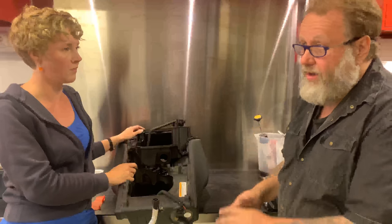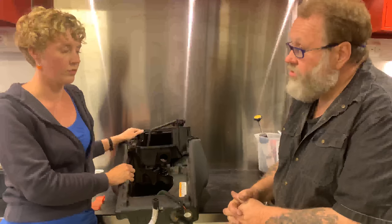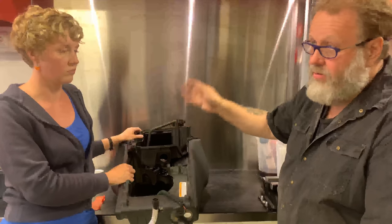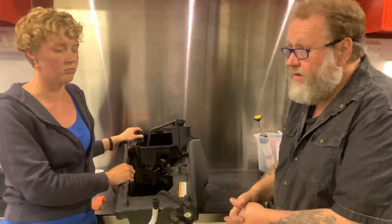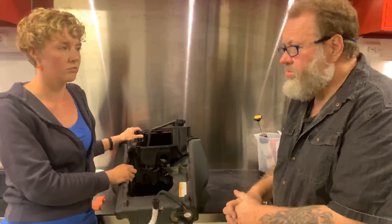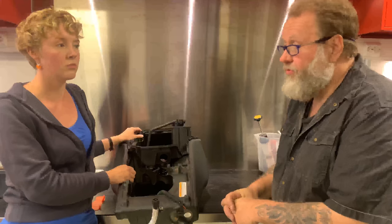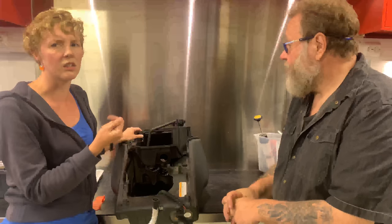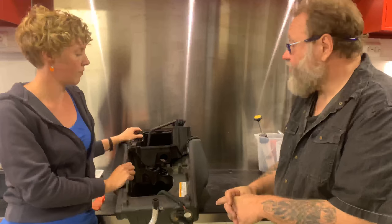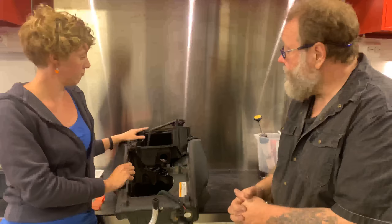The fuel system has vented, depending on how old your bike is, into this charcoal canister for a while. So the first thing you do after you remove the airbox bottom is turn it upside down and let it lay for a while in case there is some liquid fuel stored somewhere. From the five or six airboxes we've slaughtered already, we have seen no liquid fuel. It's only that the charcoal smells a little bit of it. But just to be sure, turn it around, and if there is liquid fuel, it would pour out of the two connection points.